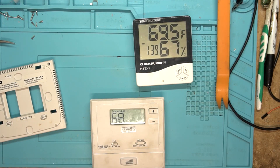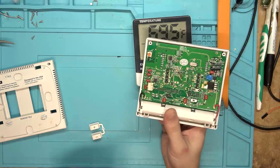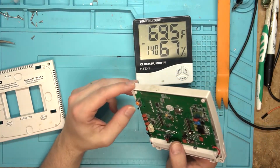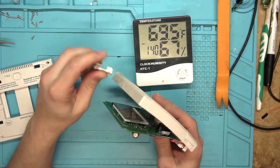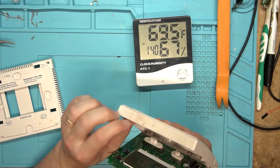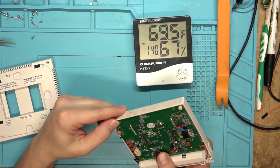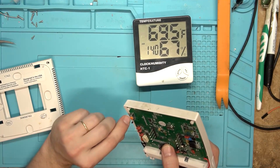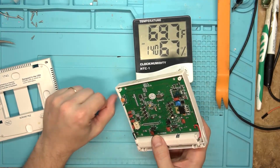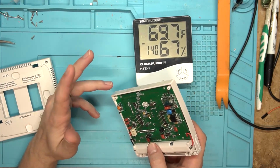Now it's been about a week since I started recording this. The potentiometer - you are able to adjust it to get pretty close to accurate; we're only off by a degree and a half, which really isn't anything to complain about. But if you bump the potentiometer at all it moves pretty significantly. The potentiometer is going bad because we're about 20 degrees off from the factory mark on here. Definitely seems to be going bad.